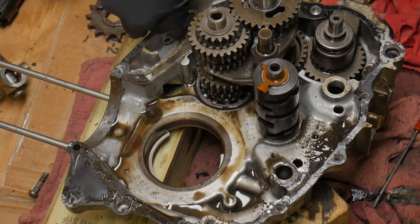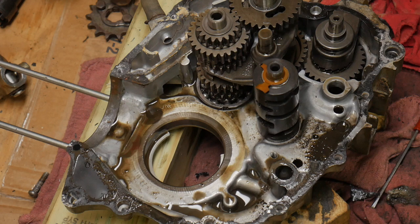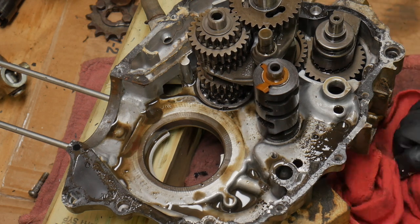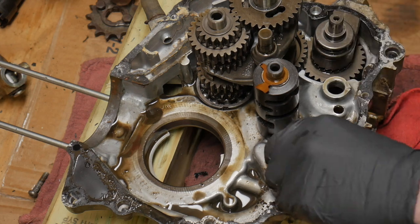See, there's our crankcase breather system right there. A lot of people don't realize, you start undoing the crankcase breather hoses and trying to make your bike look cool and maybe put a little filter on it or run it without one, and crud gets inside of the motor. That's not fully capped off. There is a way for it to get out.